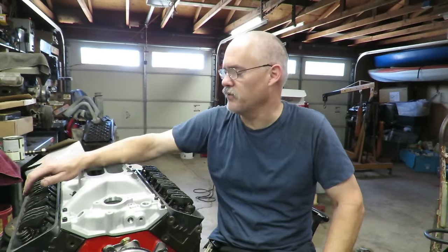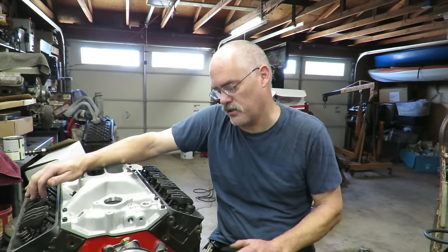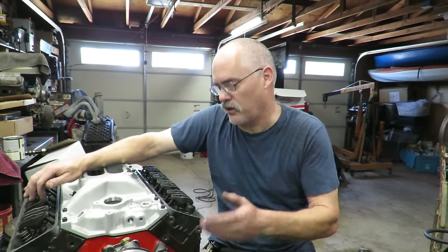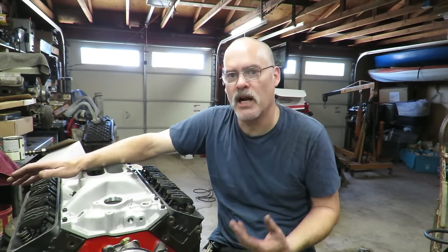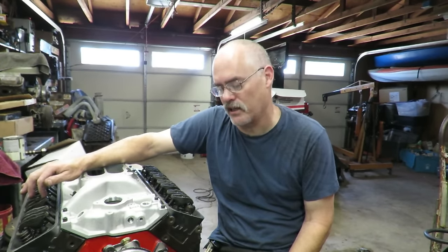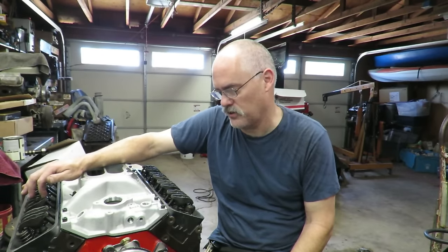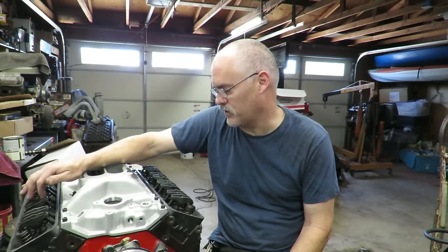You know, engine building is not cheap. It is a very expensive process. This guy, and most customers, like, he says, I want 350 horsepower, but I want it to idle smooth, and I want it to get good gas mileage, and I want to run regular unleaded. Well, there are some compromises. I told him, well, it's not going to idle exactly smooth. You're going to have a little bit of an idle because of the cam we have to use. And also, you're going to have to run premium fuel in this thing. That's the nature of the beast.